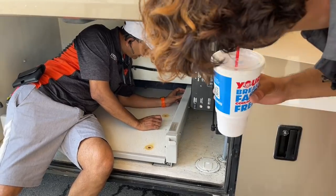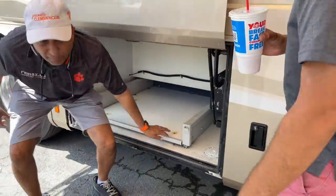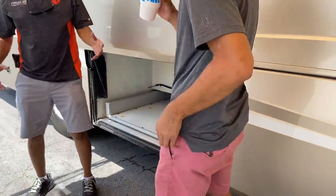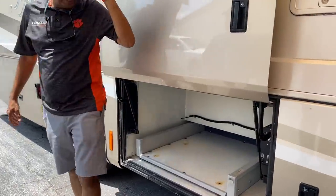This also acts as your main charger for the coach-side batteries, so that inverter/charger will keep your coach batteries charged when you have generator power or shore power. Right now the generator is supplying your coach batteries power. It's a 2,000-watt inverter, so it's not huge — some big Prevost buses have 3,400 to 4,800-watt inverters — but 2,000 watts is solid.